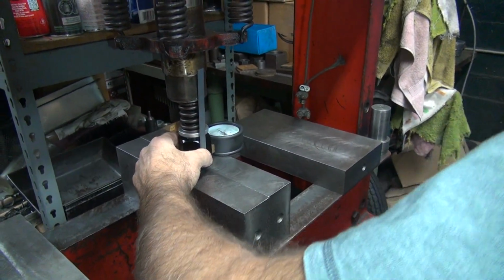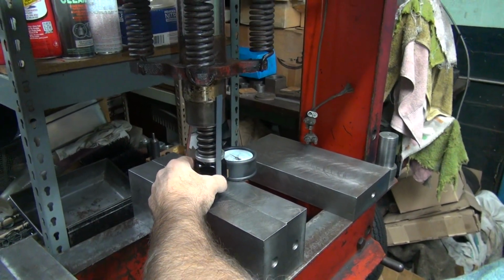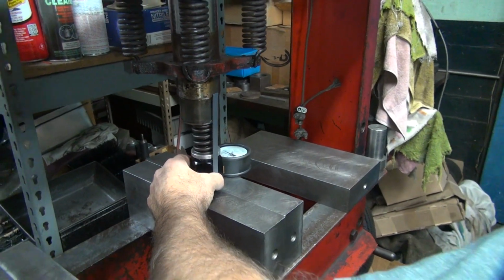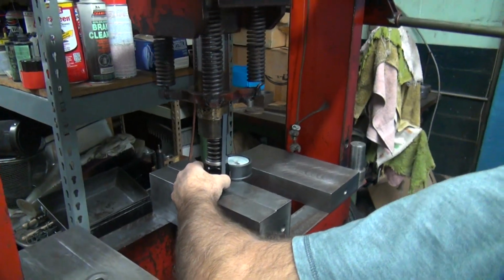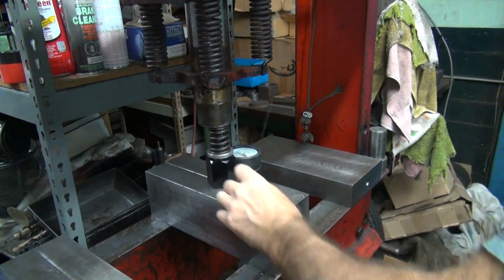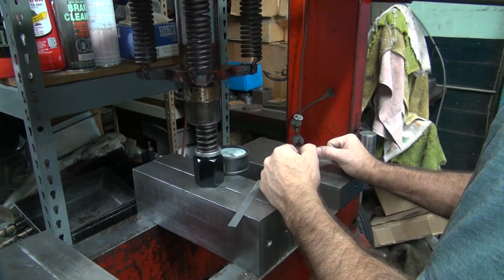What if you drop the collar or the keeper? Well, then the valve drops. I dropped one on a panhead, and the valve came out and pushed back through the head right next to the spark plug. And it came out and then went back up? Yeah, the piston pushed it back up. It was running on one cylinder, and I never saw it because it was right behind the spark plug. Oh, my God. I just thought, I wonder what the hell's wrong with my pan.